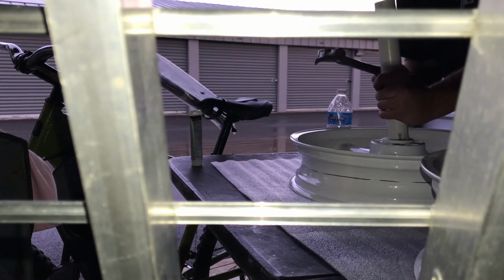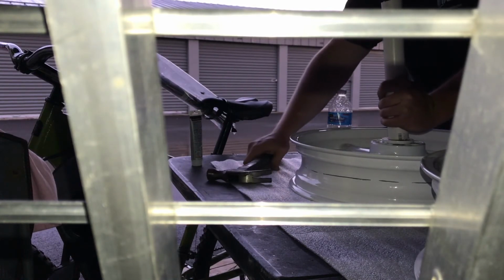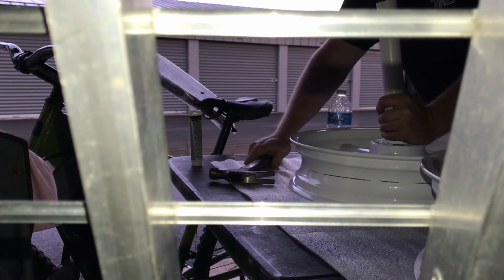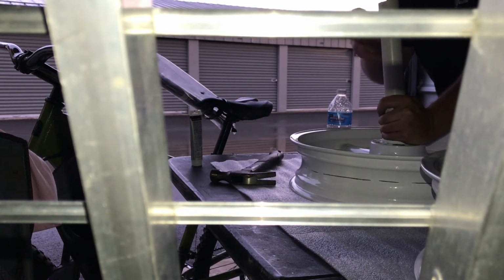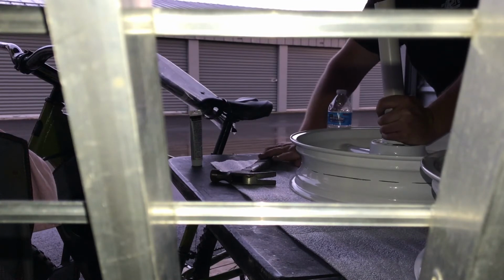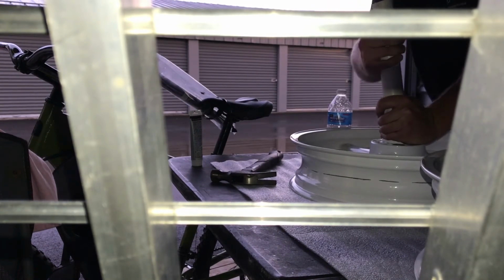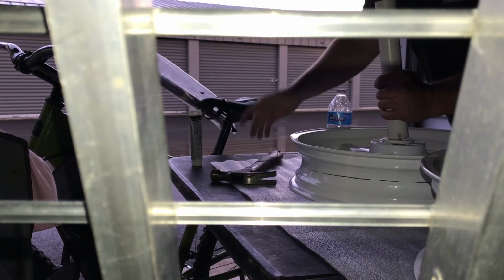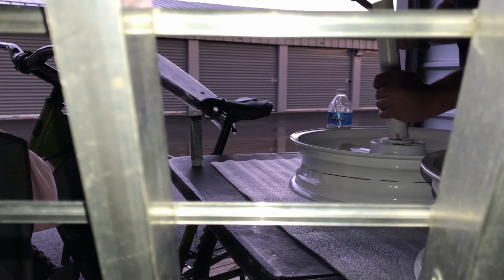They're like 26 bucks from All Bearings and All Balls, and it's great maintenance. I've had a set fall apart on me on my 98 R1. We went on a 900-mile motorcycle trip, horrible, on a sport bike, and by the time I got off, they were crinking, crunching. Took the wheel out, and all the balls came out of the bearings. It was just complete failure. I can't say I ever did them on that bike, so it could have had 10,000 plus miles on those bearings, for all I know. Just good to get simple maintenance done like this, and it's rewarding. A little bit of work, a little bit of learning, a little bit of pounding, frustration out, hammer. It's good times.